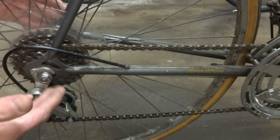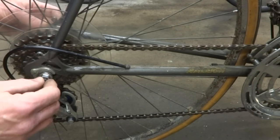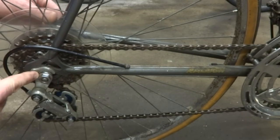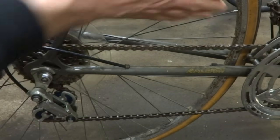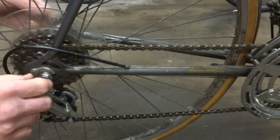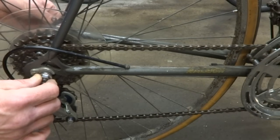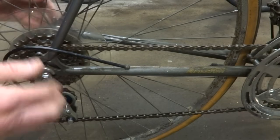Here's the same kind of setup with a solid axle where the derailleur hanger overlaps the dropout. On this kind of setup, when bringing the axle back, I like to bring it back as far as I can on this side, tighten down the nut almost all the way, and at that point adjust the wheel to where it's centered within the stays, then tighten down the nut on the non-drive side. Once both are mostly tightened down, torque them down to the final tightness.